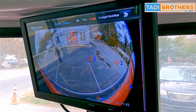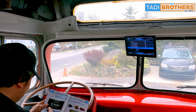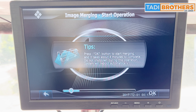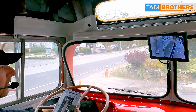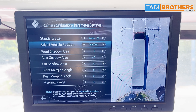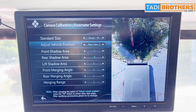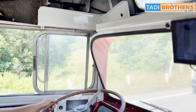The left and right side cameras are not much different from the front — the crosshairs are just longer and more spread out. The next step after calibrating all four cameras is to go back to the image tuning section and select merging computation. This will take a few minutes. Once complete, you will get a full bird's eye view of your rig. Afterwards, you can make any adjustments in the camera calibration parameter settings, including adjusting the vehicle position in the front and rear shadow areas — we'll go into more detail about all the features in our next video. For now, the system is ready for us to take on the open road, though maybe we have a few more things to finish up first.